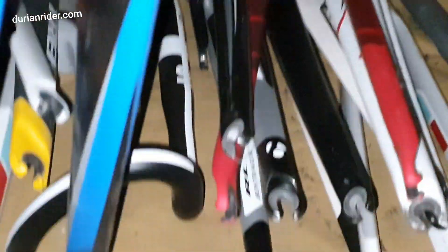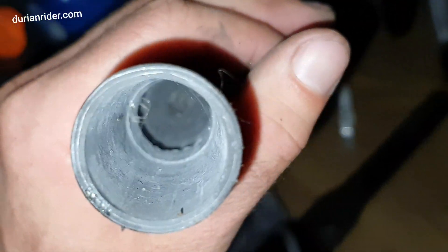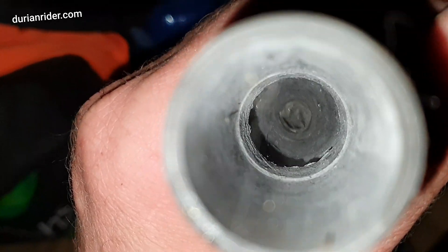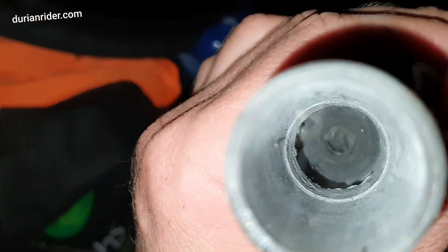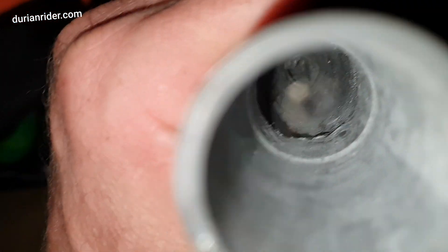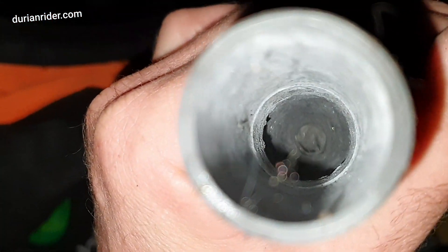Let's have a look at a Specialized fork. This fork had the ring of death, so what I did — it would be a shame to just chuck it in the bin — I cut it at where the ring of death was, that bearing line. So this fork can be used again. Have a look inside: you can see the long legs, the carcass, wet skin. That looks okay — there's no flaking off. There's a variation in thickness to thinness which is fine. That's just where the joint is on the inside.